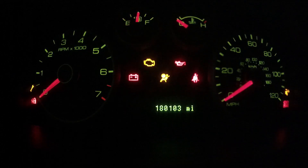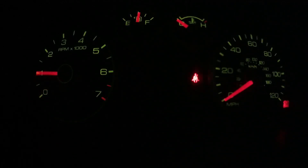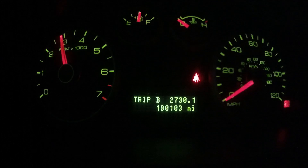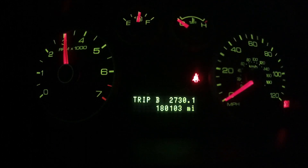So let's turn on the engine. We'll rev it up for about 30 seconds. What we're doing with this is basically get rid of all the pockets of air inside of the system.